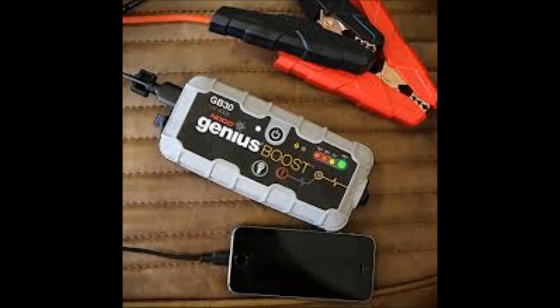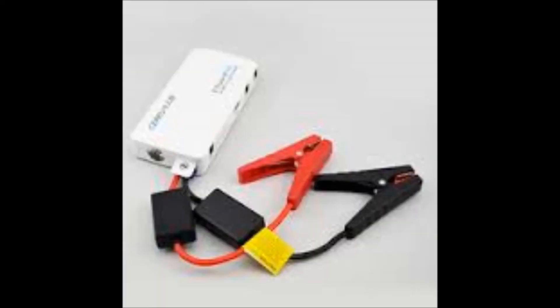It's probably going to be inconvenient to bring it every time you go to your vehicle. But one way around it is: every time you leave the house, grab this booster pack and bring it along with you — then it'll work okay because it'll never have the opportunity to get cold. But if you leave this lithium type in your vehicle and go to reach for it with a low battery, you're going to be disappointed — it's probably not going to do the job. So I would recommend the other type, the lead-acid type — the big, bulky ones. Price-wise, they're roughly comparable, though quality varies.